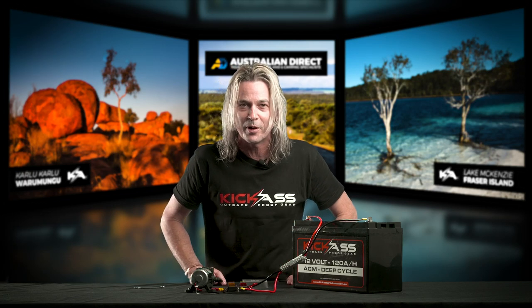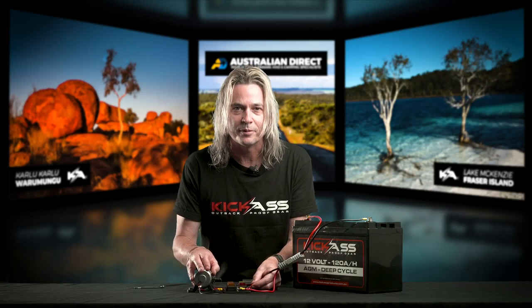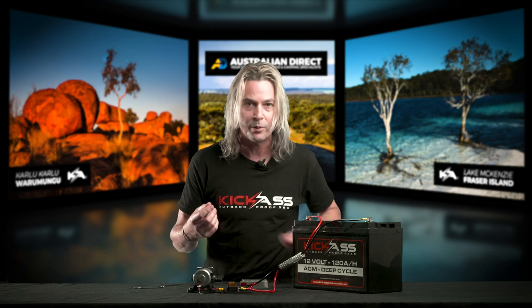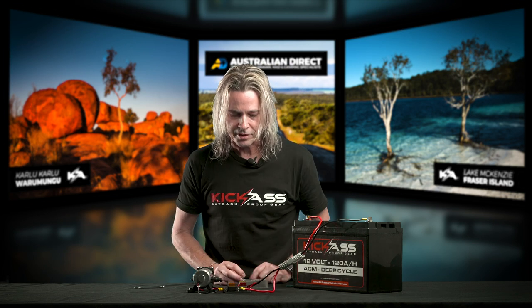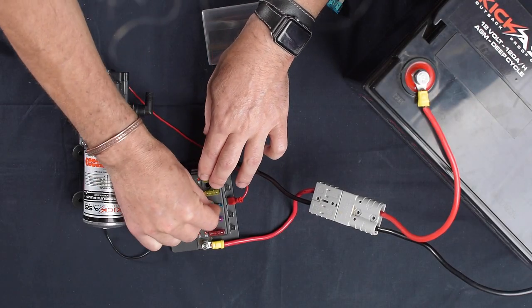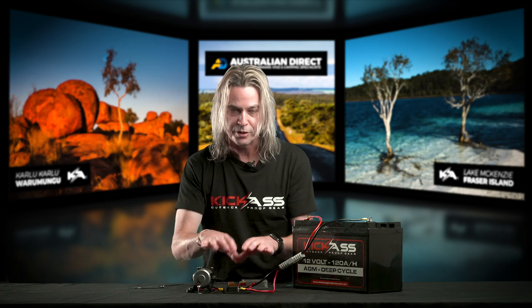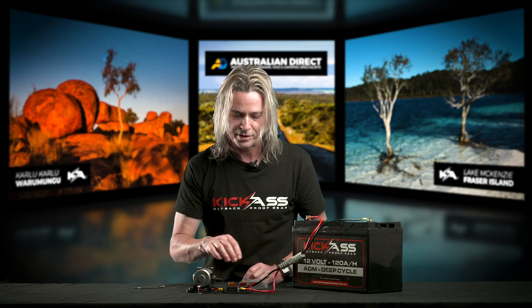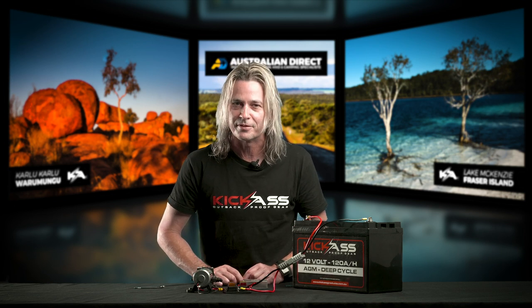And I'll quickly show you now what will happen if there is a fault with the system. Okay, so now that we've got the pump, you can hear it, it's running. Now what I'll actually do is simulate a blown fuse, which I've got one here. So as you see, a blown fuse, no circuit. You have the little LED light, and that way amongst all your fuses at night time or daytime, you can quickly see what fuse is actually blown. It'll only light up on the blown fuse itself, which makes it so easy for diagnosis work.